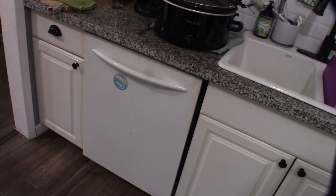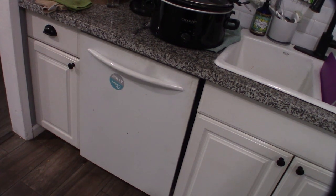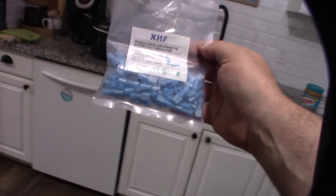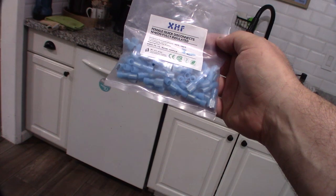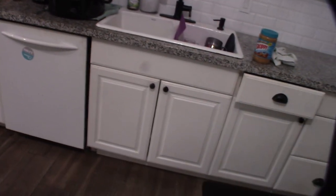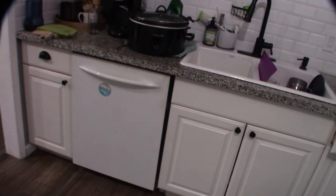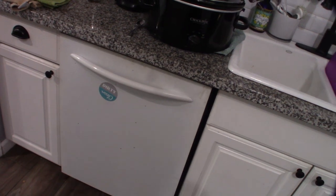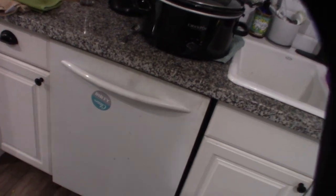In my case it was all of them. So I went through the whole dishwasher, pulled it out, flipped it over, and replaced every single connector that had a spade connector on it with new ones. Ever since I did that, I've had only one problem. The dishes clean well, I haven't popped a thermal fuse — and since I did the conversion to a self-resetting fuse, it just self-resets. The heating cycle works perfectly fine.